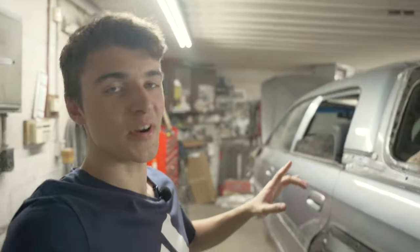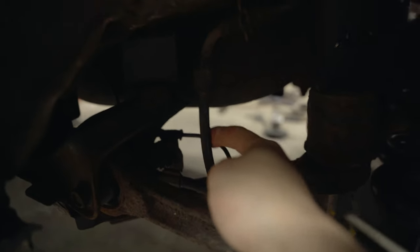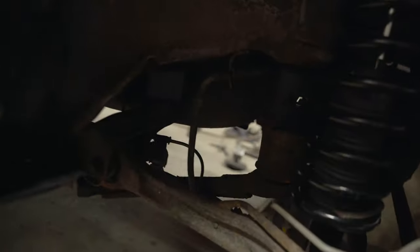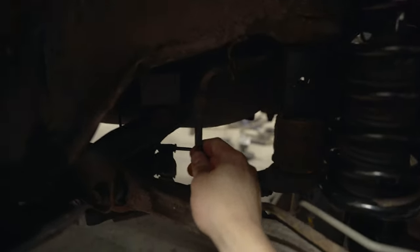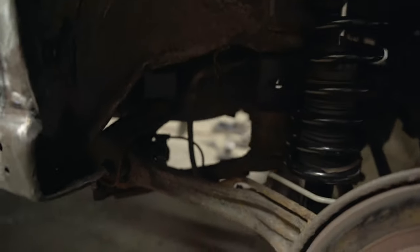The last thing for the back has to do with the brakes. There's a brake hose down here — obviously it's jacked up so it's hanging more — but there is tension on it. This could be at the limit of travel with the lift because it's already all the way down, and I don't really like that. So I might try to find longer brake hoses, because I don't want all that tension on the old hose. I don't really want to lose brakes.